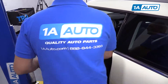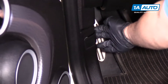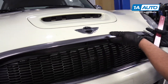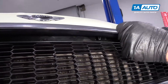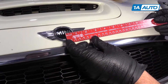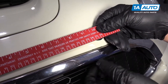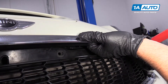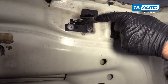Open the door. Over here, down near the footrest, there's a little lever. Pull that lever. The hardest part about this is trying to find the hood's safety latch. It's over in this vicinity. What you want to do is take a ruler or a tape measure, line it up with the eye, and go over nine inches, and then grab underneath there — you're going to feel a little lever. Push up. That's the lever.